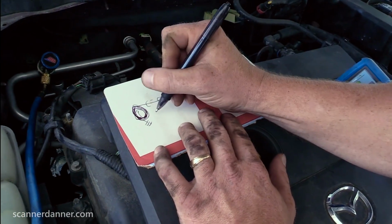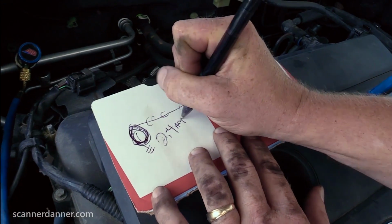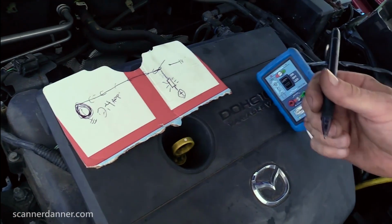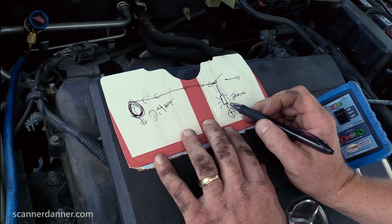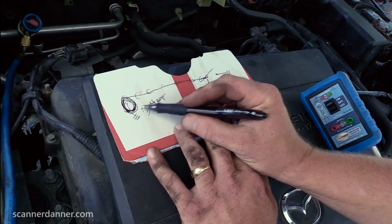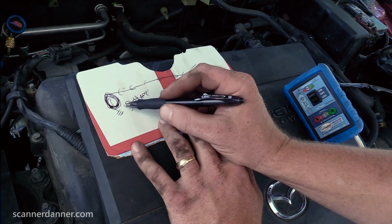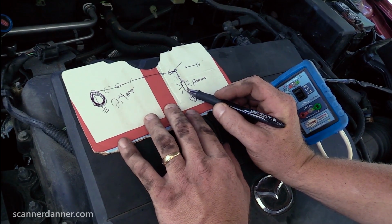Most compressor clutch coils will draw 2 to 4 amps, somewhere in that range. My test light only draws about 200 milliamps. No problem lighting that test light through the clutch coil circuit. It won't be as good of a ground as a straight ground, but 2 to 4 amps, that's a real low ohm circuit. That light should be bright, okay?